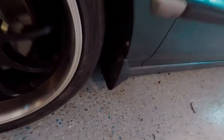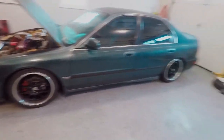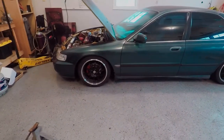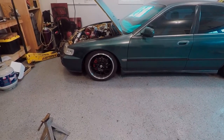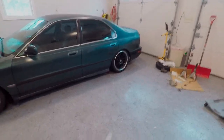I don't see any major clearance issues underneath the car - we've got pretty good gap everywhere. But my mud flap is like two inches from the ground up here, which is pretty close. That's probably going to rip off on a speed bump. The back is definitely going to come up to meet the front, and then I might take it for a test drive to see how well it does at that ride height. I just want to find the absolute perfect ride height for this thing.